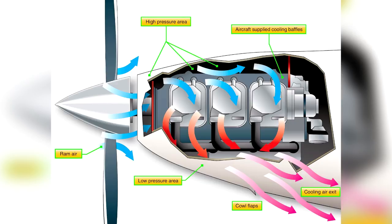The outside air enters the engine compartment through an inlet behind the propeller hub. Baffles direct air to the hottest part of the engine, primarily the cylinders, which have fins that increase the area exposed to the airflow. The air cooling system is less effective during ground operations, takeoffs, go-arounds, and other periods of high power, low airspeed operation.